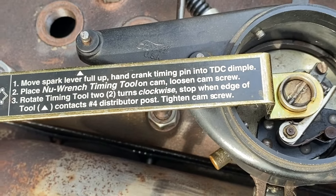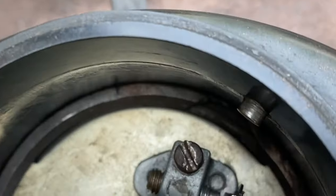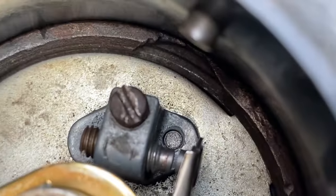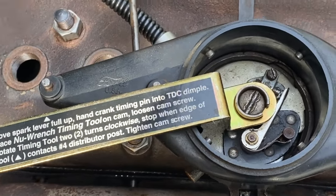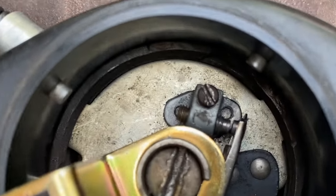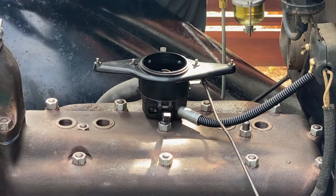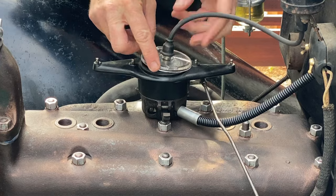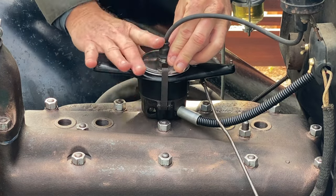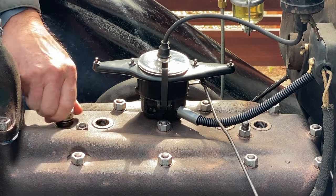The arrow is at number four, and you can see there are directions right on the tool — how cool is that? Now let's look at the points. Here are my ignition points — see, it's open. We're good to go. On goes the rotor and then the distributor cap. I got this nifty clear distributor cap — it looks so cool at night because you can see all the sparks, and even during the day you can see everything rotating. Spark plugs in, and I want to set the tension on all of these ignition straps.